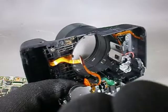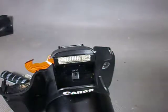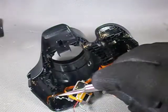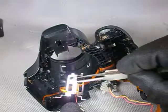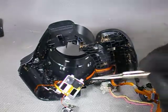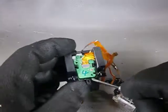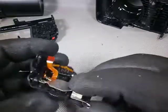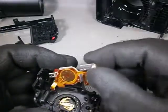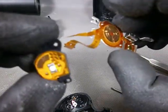Now we need to remove this encoder — just two screws. And there goes the battery compartment. I removed a screw under the flash and it goes off that easy. Next I removed two screws that held these two tactile switches. What is left is to remove this flat cable, which is held in place by some mild adhesive. My suspicions are now confirmed: under the flash screw there is still some kind of viscous liquid. I removed two screws and this board is now loose — it contains the high voltage converter. Now we need to inspect these switches. I removed two screws here and, yes, more ants. Here is the tactile on/off switch. And over there I removed three more screws to inspect the zoom control and shutter release.